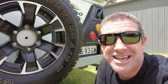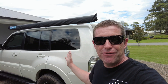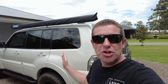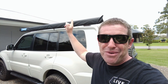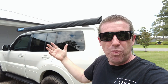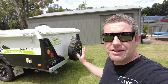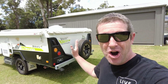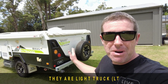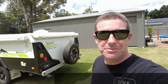So that makes it pretty much 8 years old. With your regularly driven vehicles you'll typically wear the tyres out before they reach that critical date mark, so it's usually not such a concern. It's if you've got a car lying around — or trailers where the wear isn't really all that high — that it's very easy to run those tyres out so they're 10 or 15 years old before you even realise. So I'd strongly suggest to anyone with a Jayco camper trailer: if you've got an older model, double check your tyres and make sure they're within that age range. If not, head down to your local tyre shop and get them changed as soon as you possibly can.